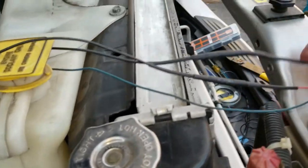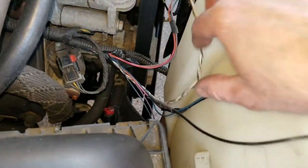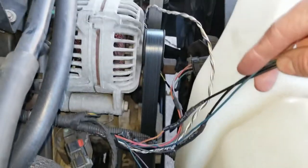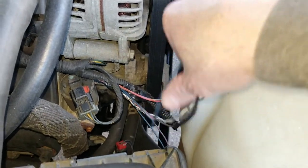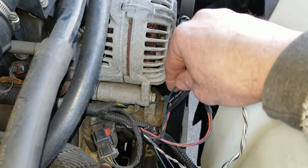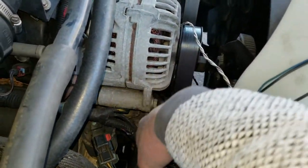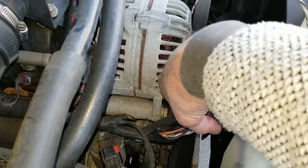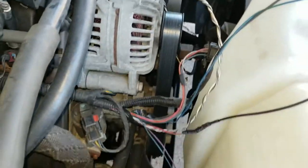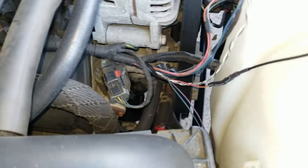You can see I've gotten the splices made up on both ends now — went pretty well. So I'm ready to start putting things back together. I am going to go ahead and try to tidy up this harness a little bit with some electrical tape. I'll re-tape these three wires together to go to the crank sensor. Then I've got some new wire loom that I can put around the whole bundle to protect everything, and once I get the loom on I'll wrap some more electrical tape around the outside.